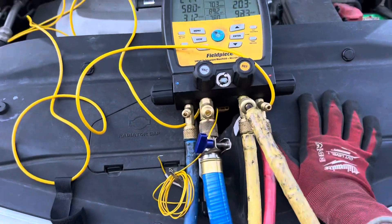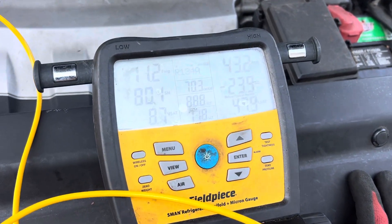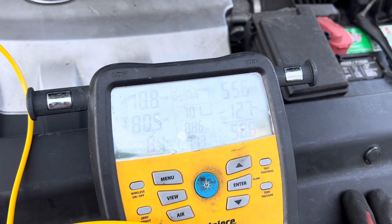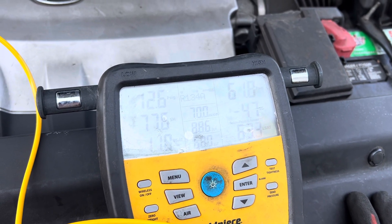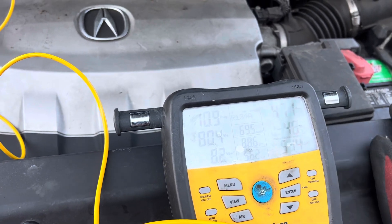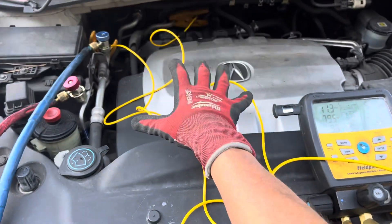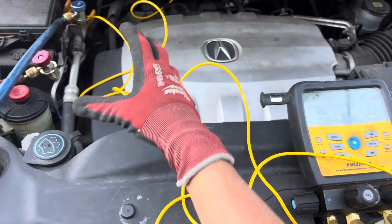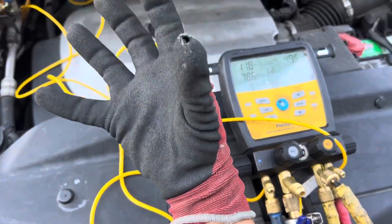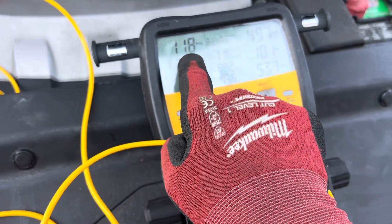Now running: 17, 14 on the low side, 98 on the high. We don't even have a high idle because it's already warm — that's why the static pressure was high. It's only 68 degrees outside but the engine's warmed up, the inside of the car is warm, the pipes are warm, so the gas inside the pipes expands and pushes the pressure up. Now we've got 11 on the low side.